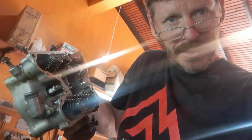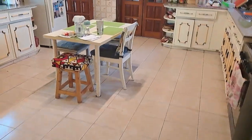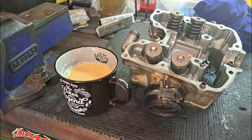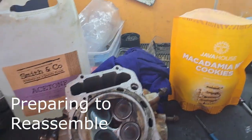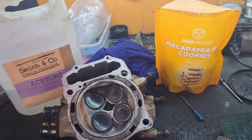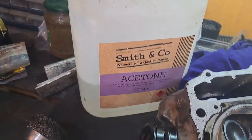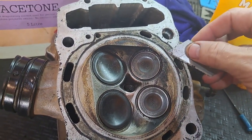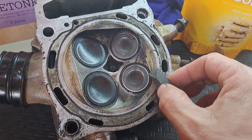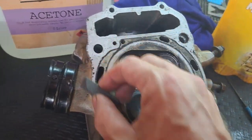I'm gonna go and see if anything's going on in the kitchen. Pete is making tea - fantastic! We're gonna clean this thing up. I'm going to use a wire brush inside here, but not on the flat surfaces. For the flat surfaces I'm going to use acetone and a flat blade to try to get off some of these old bits of gasket rubber. At the end, a flat oilstone to carefully make the whole surface as flat as possible.